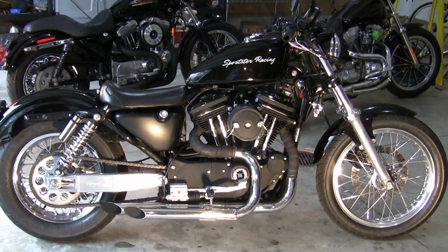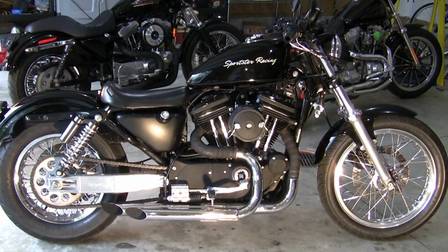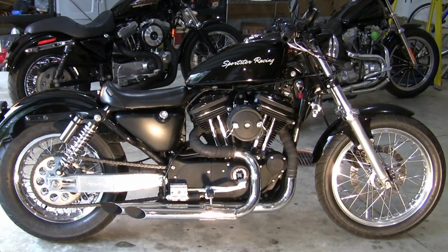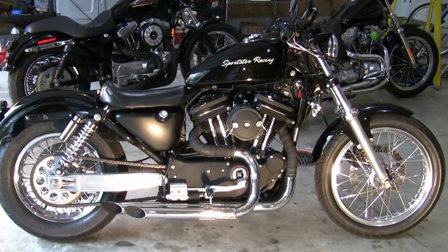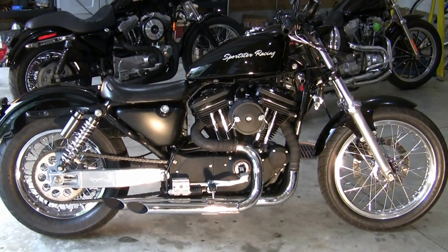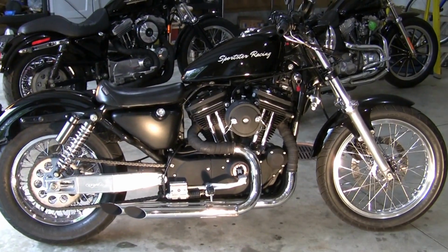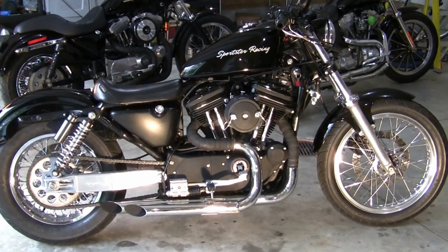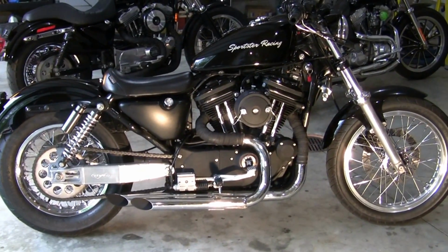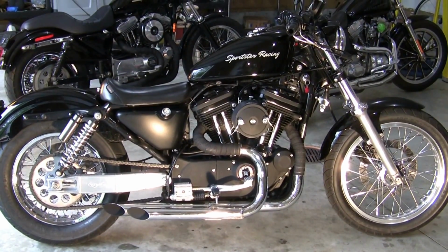I still have work I want to do to it. I've got a Patriot pipe that I'm going to try out on it. I've got an S&S D carburetor with a Thunderjet. It's got a G carburetor on it now. I've got a 48 Mikuni too that I could put on it. They're hard for me to tune though. I think they're hard for everybody to tune, unless you're a Mikuni flat slide expert.